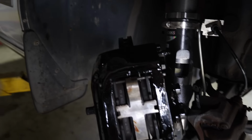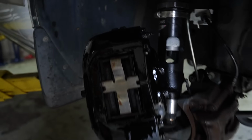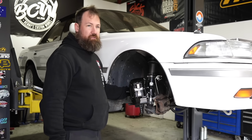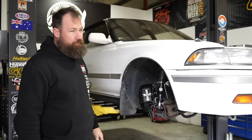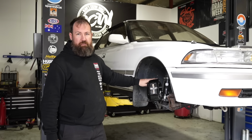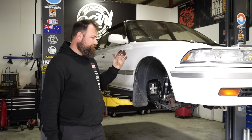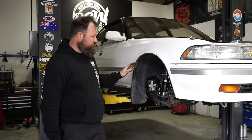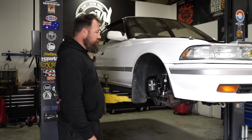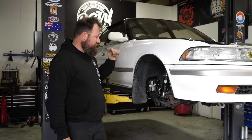So are the constructions of the brake discs with that gap in the middle mainly for heat dispersion? Yeah, that's what they call a vented rotor. So there's vented and solid depending on what the application is. Older, like when disc brakes first came out, there was a lot more solid discs. I guess even in the 70s, they started to swing towards a vented disc, at least in the front. The rear disc, even on this car, they're actually solid.